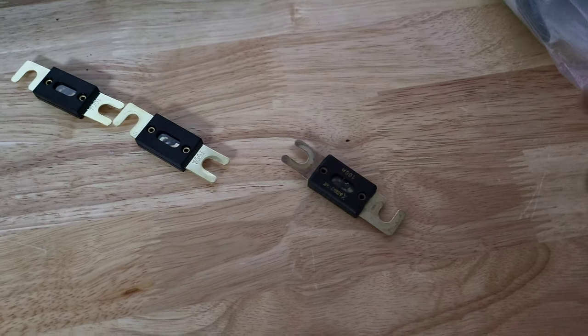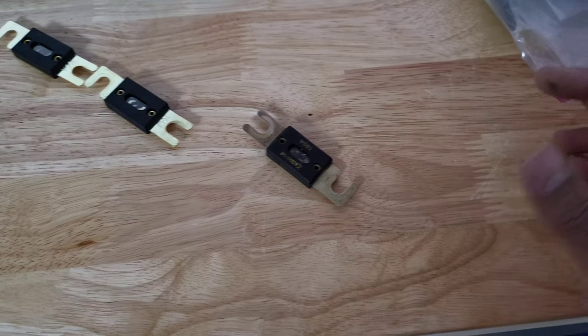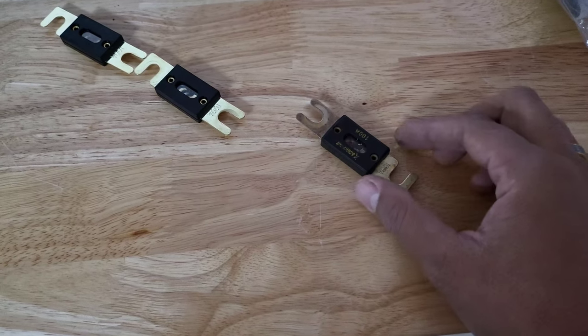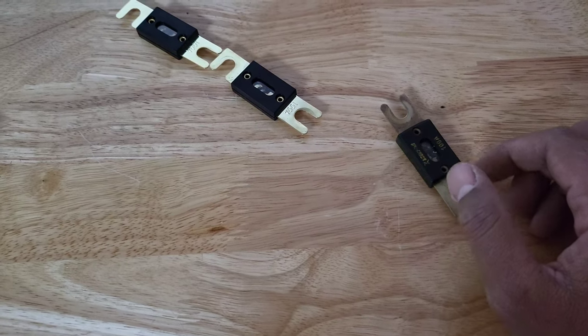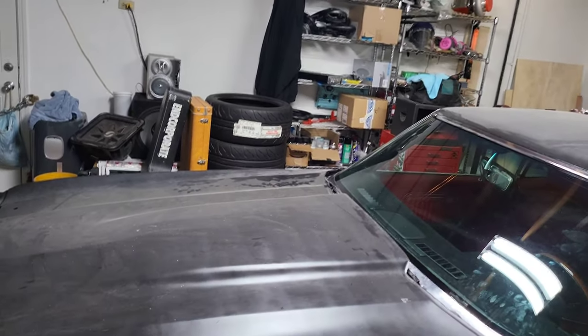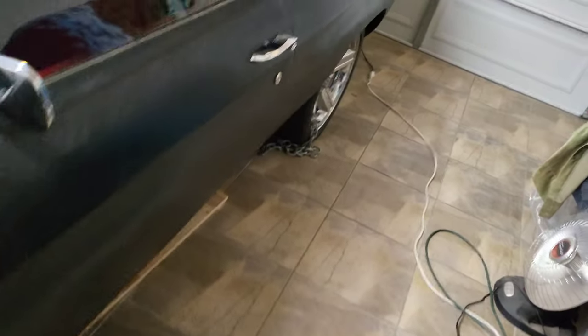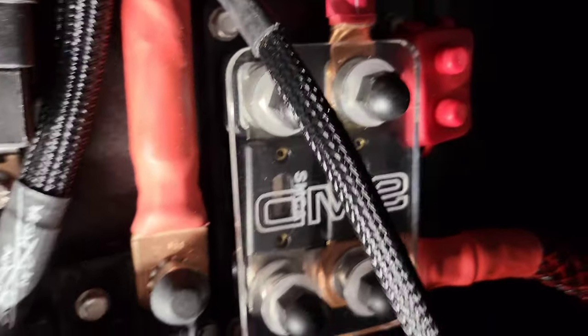I told myself, nah, maybe let's just double check. Now I'm freaking out thinking somehow I wired something wrong. I had this old dusty fuse in the box. Put that in. Boom, blew that too. As soon as I hooked the battery up. So that's internally shorted. But good news is it lets me know that my wiring was done correctly, because if this was wrong, it would have blown both those fuses.